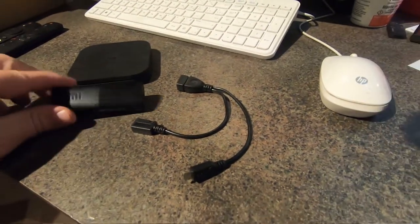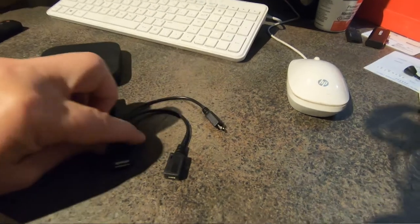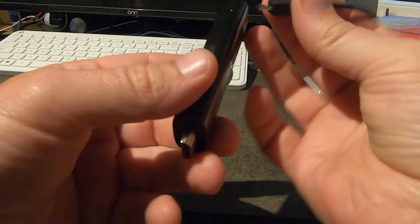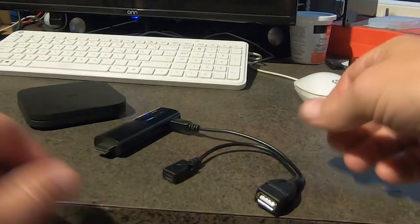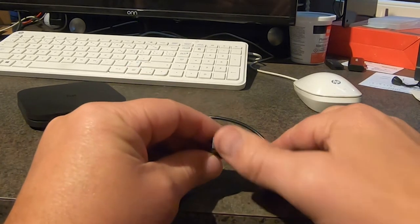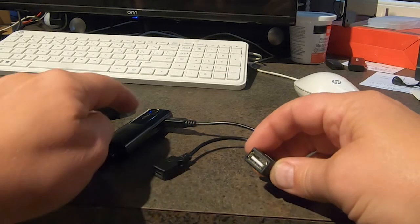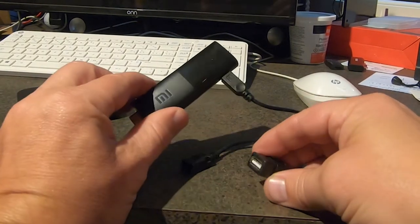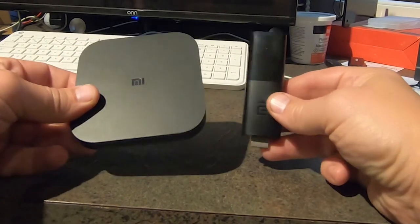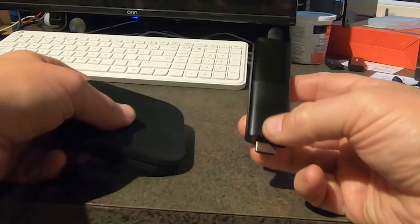I bought this because I have a micro USB to USB-A and micro USB dongle, and I thought this would allow me to plug into the micro USB port and give me a proper USB socket that I could plug a keyboard, mouse, or hard drive into while still powering the device. I did test this — it's the same one I use on my PlayStation Mini. Unfortunately, the reason it doesn't work is because this port is only to power the device and they have not hooked up the other pins required to use it as a USB device. So it will not function with any USB device, even if you add that breakout cable.